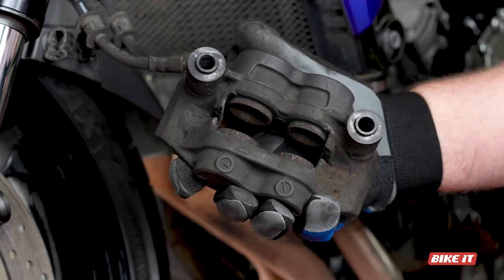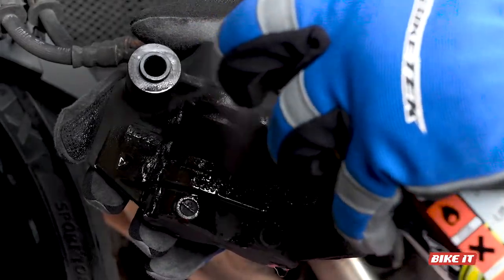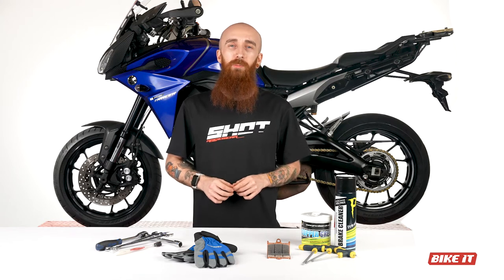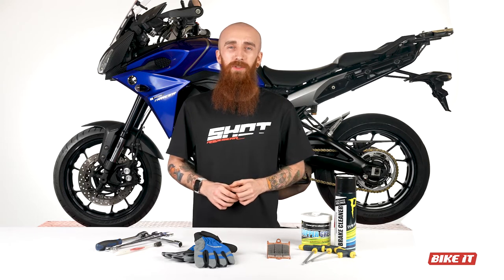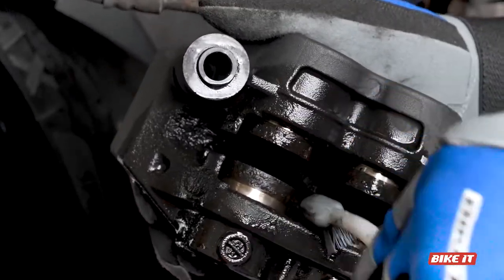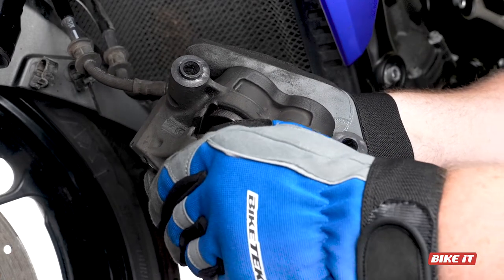You'll get to inspecting or cleaning these later. With the caliper empty of pads, now is a good time to take a good look inside. Spray brake cleaner directly into the caliper and onto the pistons and agitate any stubborn brake dust or dirt buildup with a brush — this is where the old toothbrush comes into play. Do not use a wire brush, as this will result in marking the pistons and/or damaging rubber seals, either of which will result in a bad day and affect brake performance. Make sure the exposed outer surface of each piston is clean, reapplying brake cleaner where required, and continue agitating with the toothbrush. Once all built-up deposits have been agitated, hose down the area with more brake cleaner and wipe down with a microfiber cloth. Once clean, gently push the pistons back into the body of the caliper by hand.